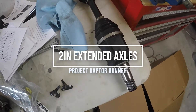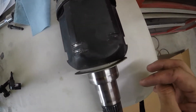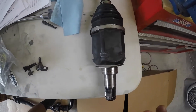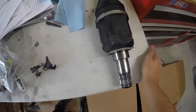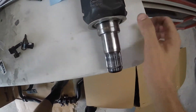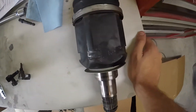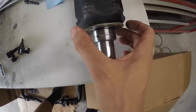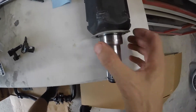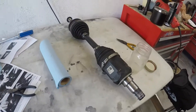The good news is I was able to get this CV axle out. This was the end giving me problems — you can see it's kind of bent here. I had to get a pry bar in behind there. I tried a slide hammer with an adapter but it wasn't big enough. They have forks you can use, but this is such a beefy axle and the dust shield limits a lot of options. I was very gentle prying it out evenly. I can get another one from Toyota and press it on, or just straighten this one out.